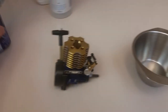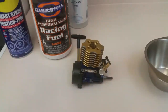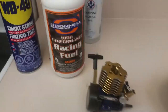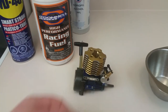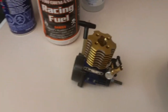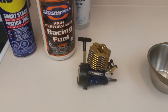O-rings, depending on your engine, can be expensive or impossible to find depending on how old the engine is. The other problem with WD-40 is if you shut your engine off and spray it full of WD-40 and let it sit over the course of a winter or a year, the WD-40 will attack the oils and fuel residue left in the engine. It'll leave a gunge that destroys your bearings, leaves a film on everything, and you can't even wash it off — it just leaves a sludge.